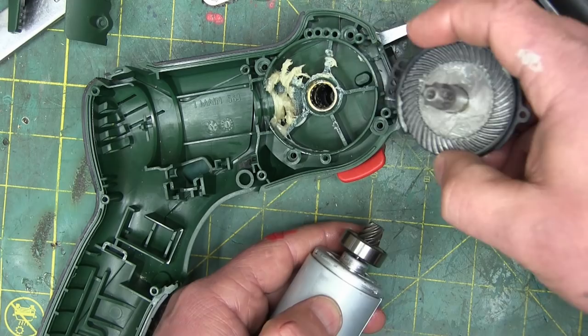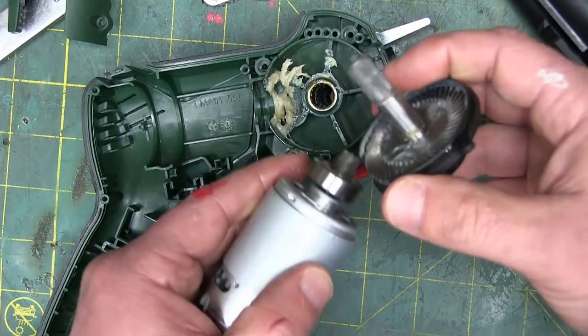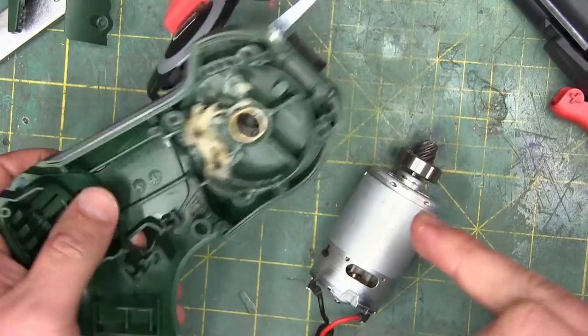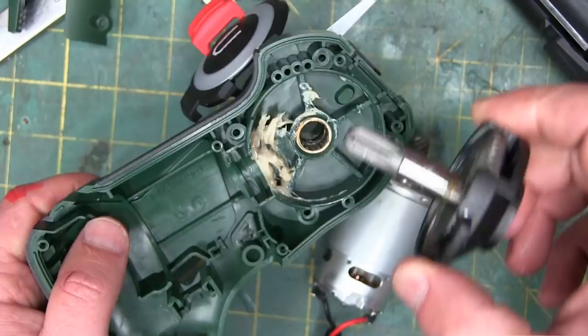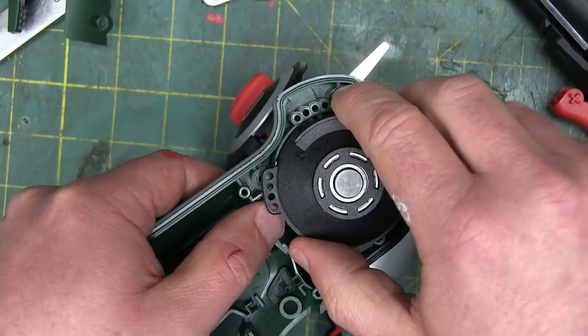You'd like to see this in angle grinders. You have a look at the gear set — if you want it to last the longest, you've got to get the contact pattern right. As it wears, it changes — the end of the pinion gets just razor sharp. If you had this on your grinder, you could change that contact pattern. Kind of crappy on the front bearing here though — no mitigation for ingress of dust, so this is going to wear out. What'll happen is you'll start tearing into it and smell the smoke as it melts into the PA6 material, but there's a nice big roller bearing in there. There should be no thrust on this way, however the only bearing that can take that up is the deep groove ball bearing in this housing. This guy moves this pin — we'll see what that mechanism is.